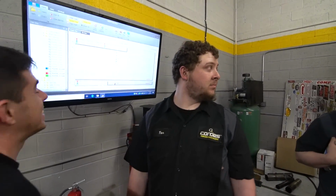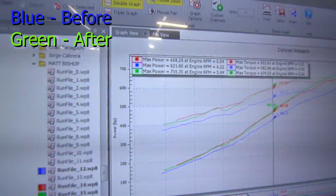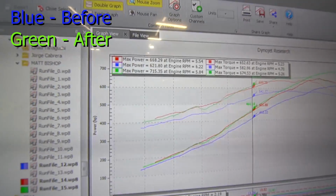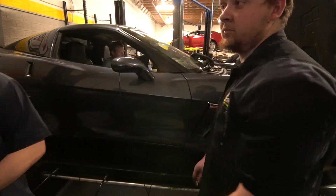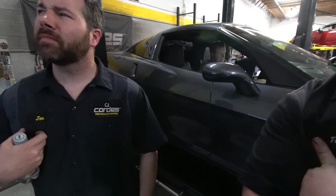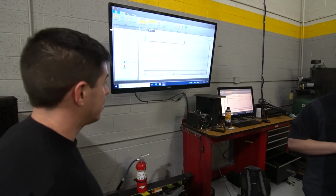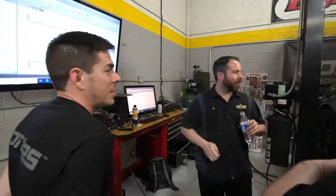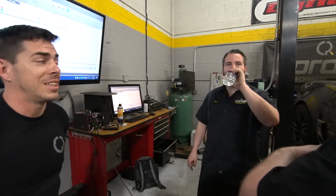The most I've ever made was on Rich Floor's LT, which is high compression. I made 750. Boost is not going up after 5,800 RPM, but it's not dropping either. It's just kind of stagnant. I bet the blower's down. The blower might be down. What did this make before all this? 621. God damn! How low's timing? There you go. 12 degrees. If this was on E, we'd go 800. Oh, well, that's gonna make a lot. It'd make like 750, 760. I think we did 800.